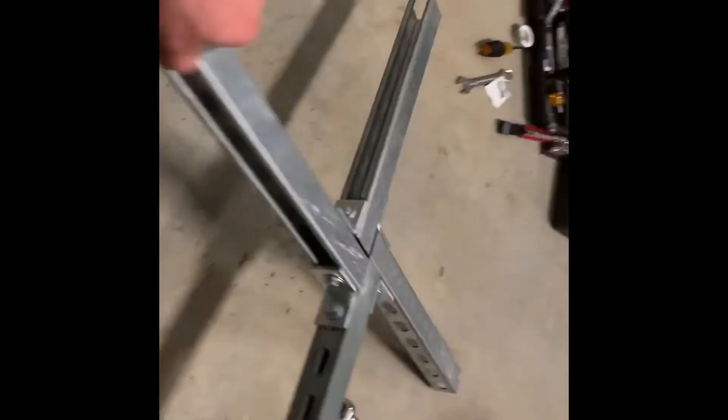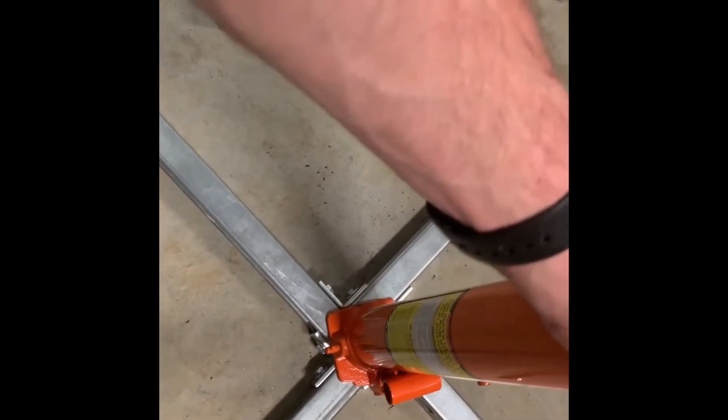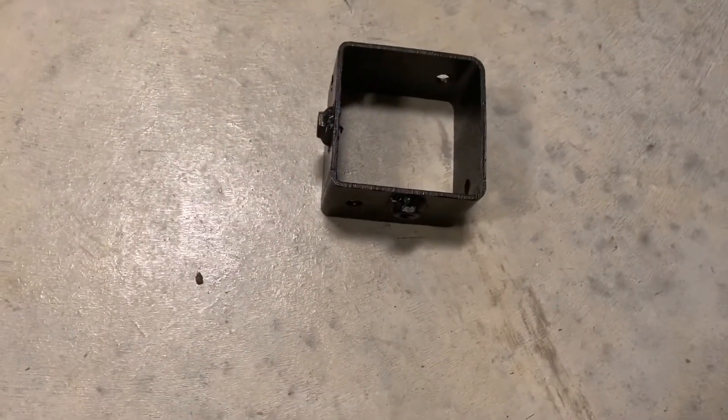This step is complete — it's a solid unit, so that's the base. It's like a giant ninja throwing star, and this will go on at about a 45-degree offset so I can do the self-tappers through here. This stuff's really soft — I just drilled through this for those self-tapping screws and then let it tap into the metal below it. This is probably the hardest part to fabricate, and it really wasn't all that big of a deal.